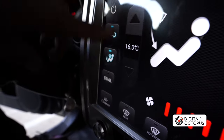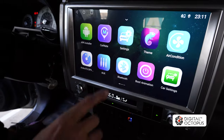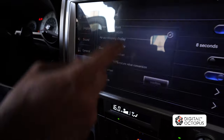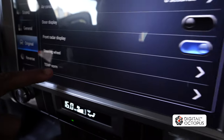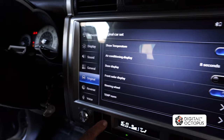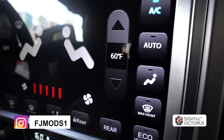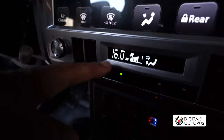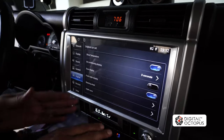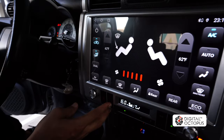I'm going to show you how to change this from Celsius to Fahrenheit. What we're going to do is go into the home screen, swipe up and click on Settings. We're going to click on Original, then swipe down and we'll see temp norm. We're going to click on that and change to Fahrenheit and confirm. So now when we press the buttons here for the AC, you should be able to see it in Fahrenheit. Unfortunately, down here is only Celsius for the moment, unless they come out with an update in the future. But you have both of them right here — you have it right on the screen as well.